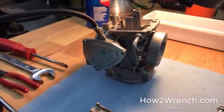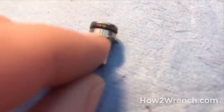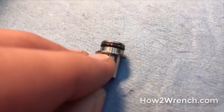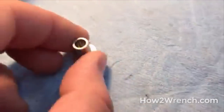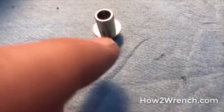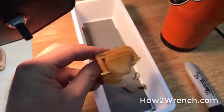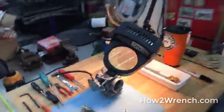This is off a four-wheeler. Let's see if this will focus in — do you see all that crap on the o-ring? All that junk right there. I don't care how much you clean in here where the needle valve goes — if this is not clean or does not have good integrity, the fuel will bypass right around that, it won't be able to shut the float off, and you're going to leak fuel every time. Textbook.